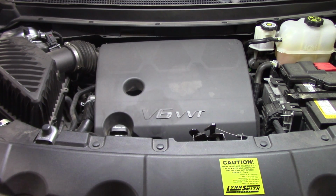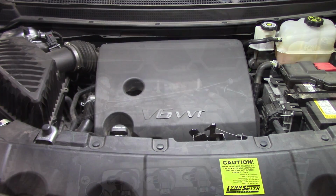And that's going to include removing the battery or disconnecting the battery. And then we need to also depressurize the fuel system on this vehicle. Now, in our case, we're using a Snap-on tool, and there's actually a specific function within the tool that allows us to depressurize the fuel system before we go and remove any connections to the fuel causing any pressure issues. So we'll do that. We'll get the depressurization done, we'll get the battery disconnected, and then we'll go from there.